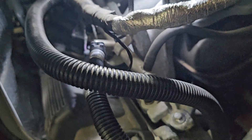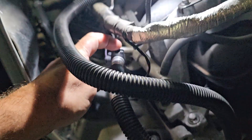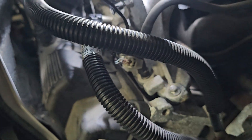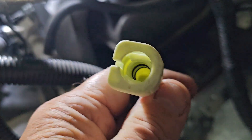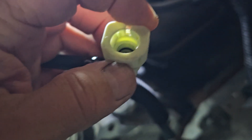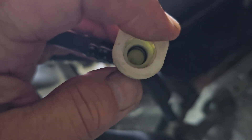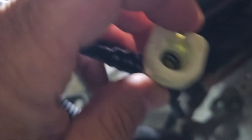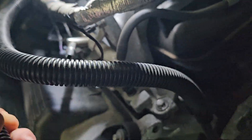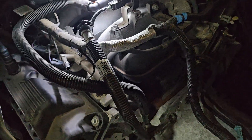So we're going to take this little red safety clip off first. Now what I'm talking about is always on the opposite side — I've had a couple people email me about problems testing this. On the other side there's a little push connector. It pushes up a little bit and you can see the little clips releasing. We're going to push it — gotta watch out for fuel.